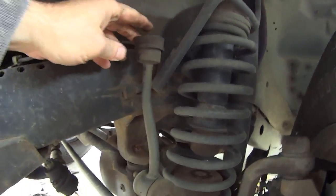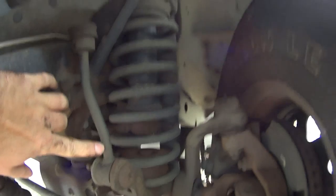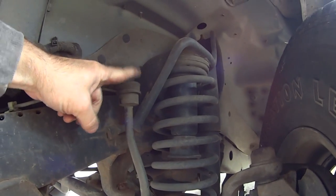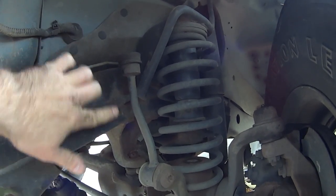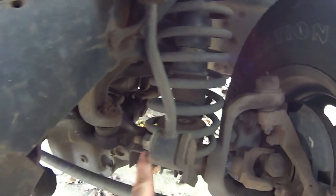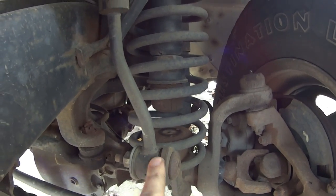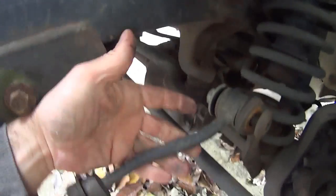Okay, we're on the driver's side right now. Notice how these end links are bent — they are bent from the factory. When you put them in, this is where your sway bar is going to connect, and down here is your axle. They tilt inward and come up to the inside. If you get that backwards down here, all you do is cause yourself a headache and extra work because the sway bar will not go back on. So save yourself the trouble and put them in the correct position right the first time.